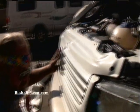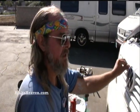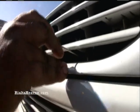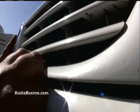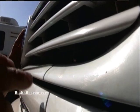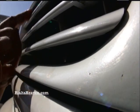While the fluid is warming up, you can start checking what you need to do to this piece of the grill. If you look down in here, you can see our top hose clamp that's hitting this piece of the grill. Try to make sure your grill is pretty much centered over the mounting screw holes, and then try to put a little mark right in the center of that. This bottom piece is aluminum, so it's a little more difficult to cut that notch into. But with any luck, that's the only thing we'll have to do and this will be ready to pop into place.